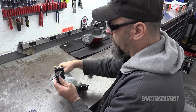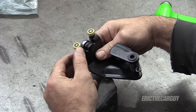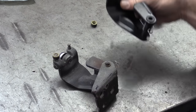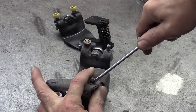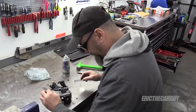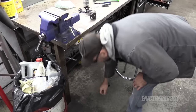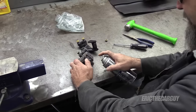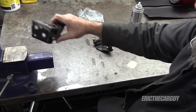Here's the new part. As you can see, the wheels are nice. But we don't have this piece, so we've got to swap this over. Let's start by removing this clip, which I'm just going to dig in here with a screwdriver. Don't lose that. Maybe a little penetrating oil. And then this pin will come out simply by knocking it through. Once you get it past that little knurled end there, you should be able to pull it through. Taking this over to the wire wheel to make this easier for reassembly.